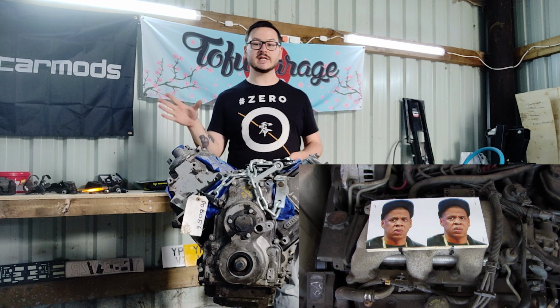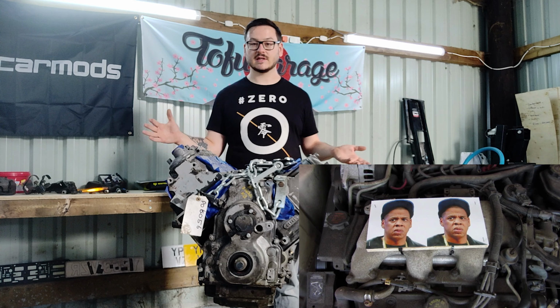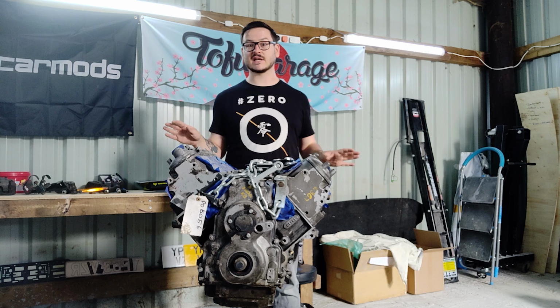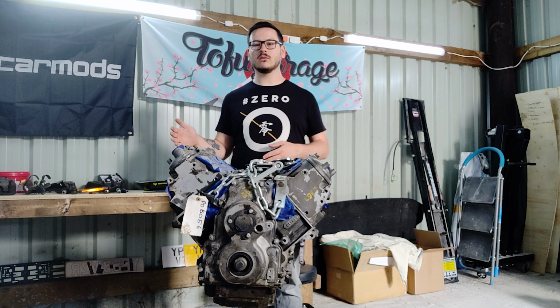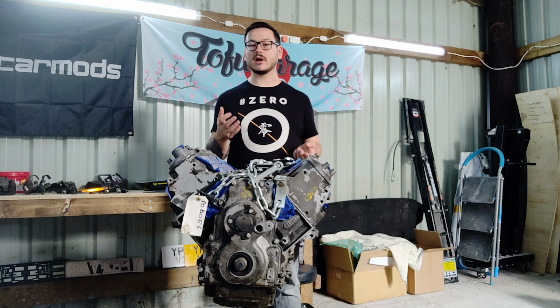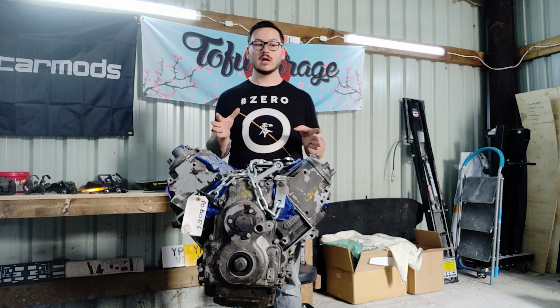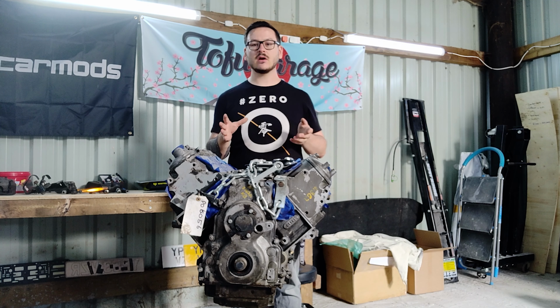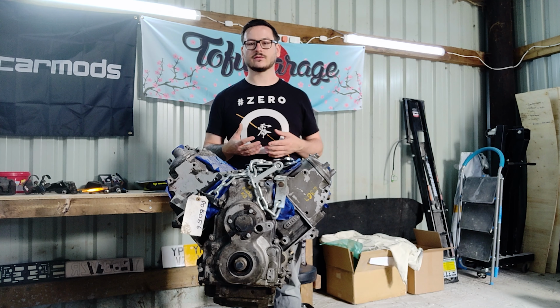The other thing is the 2JZ. It's a Toyota engine, makes sense to, again, keep it in the family. The problem with those, personally, for me, is they're fantastic engines, but they are a little bit old now, and they're very, very heavy. I think they're a bit over the 250 kilo range, whereas the FA20 engine in the GT86 is around 180 kilos, it's often thought to be.